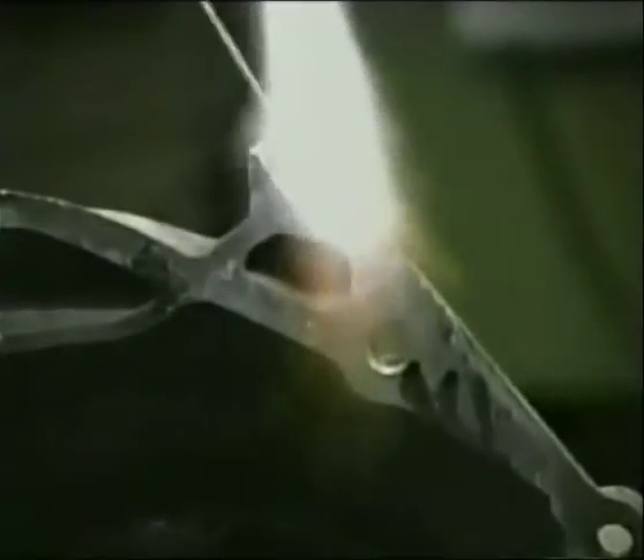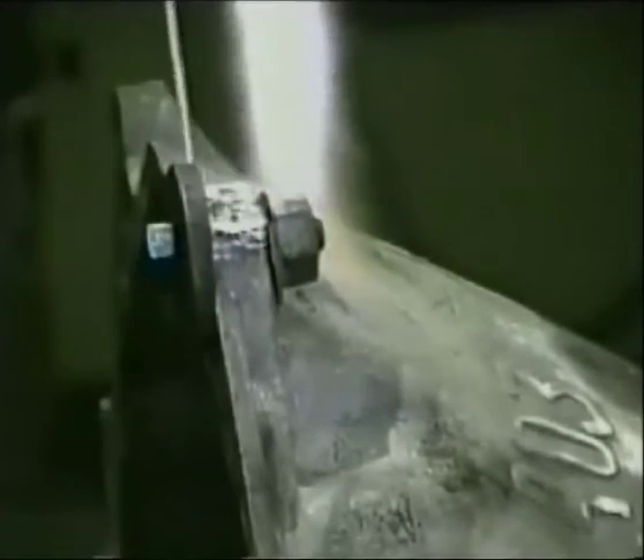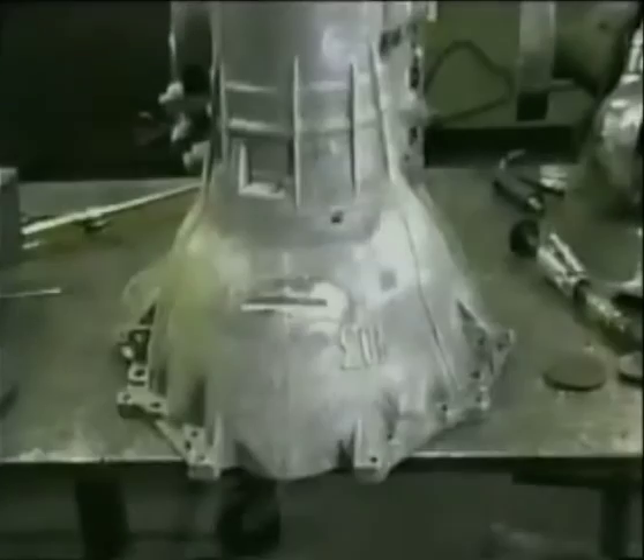When just part of an ear is missing, like in this case, a steel bolt, a nut and two washers work easily to form a new one. After the broken area is tinned, the rod is melted over the bolt in between the washers. When cool, the bolt is removed and the ear is sanded and shaped. HTS-2000 makes permanent repairs. Time and vibration do not affect it.